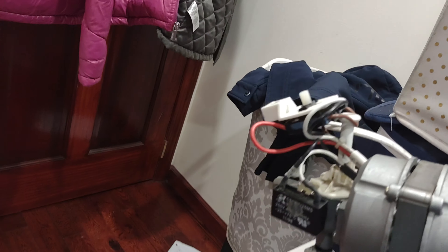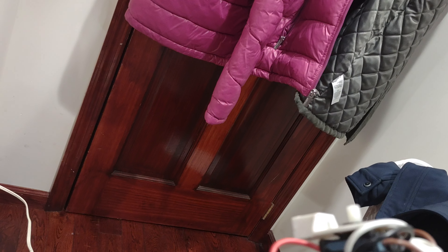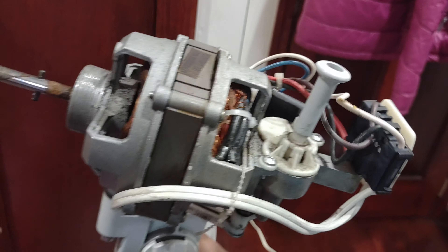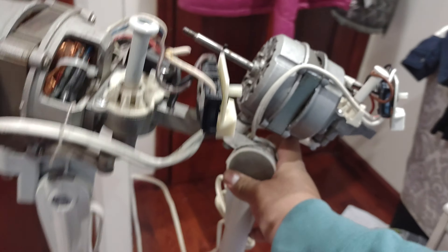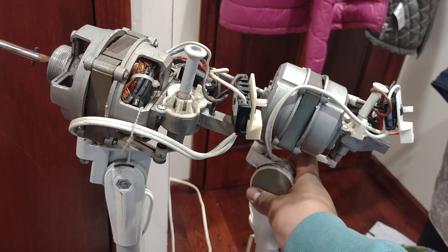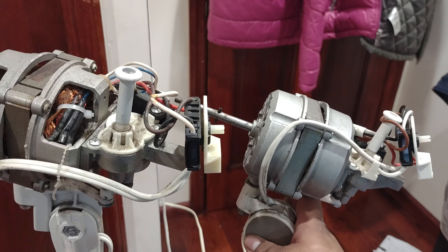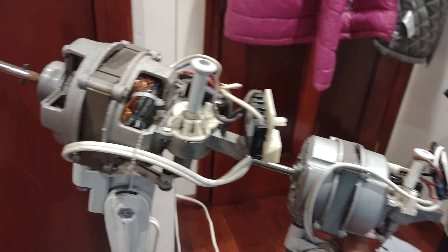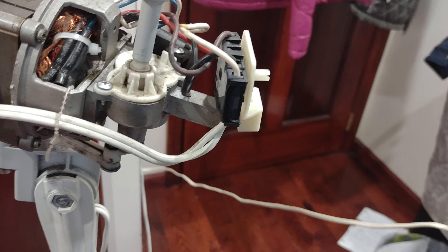The oscillation knob and everything are pretty much the same — there's nothing really that different between them. But here's another difference: the way the wire is wrapped around the fan. Side by side you can see that the 1998 version uses a clip to hold the wire, while the 1994 version is tied up to the motor shell.